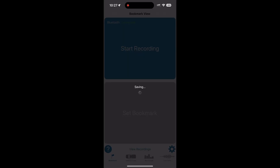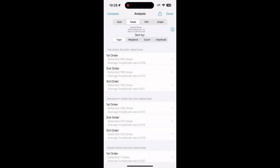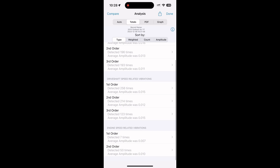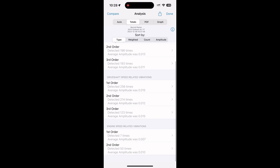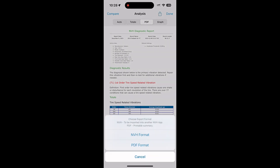When you click Save, the app is immediately going to tell you what it thinks it is — and it's usually right. We have a Tier 1 tire vibration, and as you can see we had 491 Tier 1 detections on the tire. That means there's one spot on a tire that is causing a vibration every time it rotates 360 degrees.